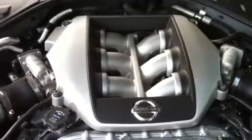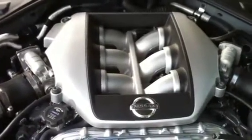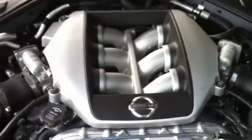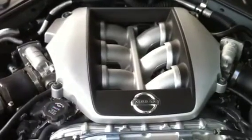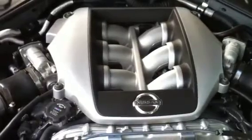What we're aiming for is best mass airflow, and then making efficient use of that depending on the octane of the fuel that we're using, by using the appropriate ignition timing to get the mixture to light off at the right time to give a nice smooth even burn, where none of the mixture explodes before the flame front has reached it.